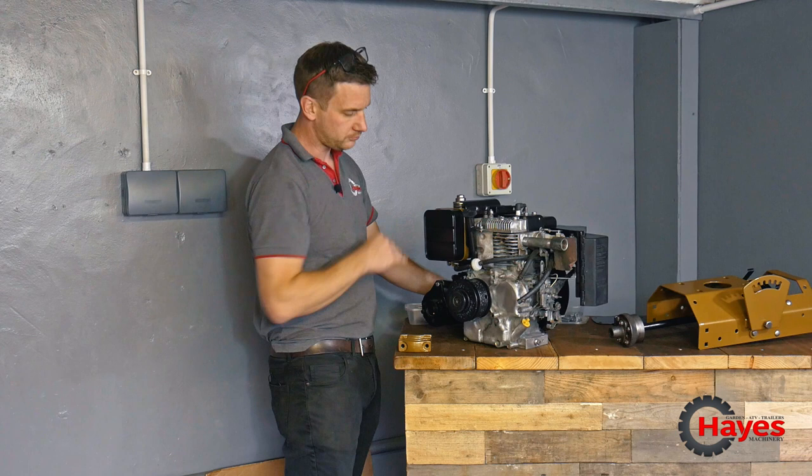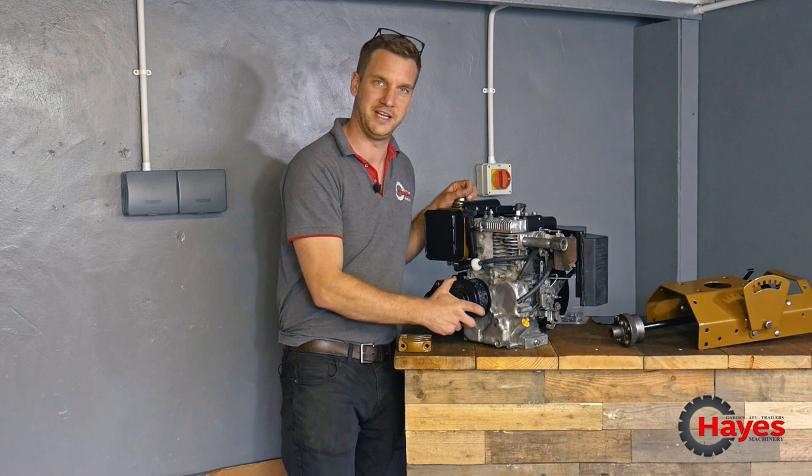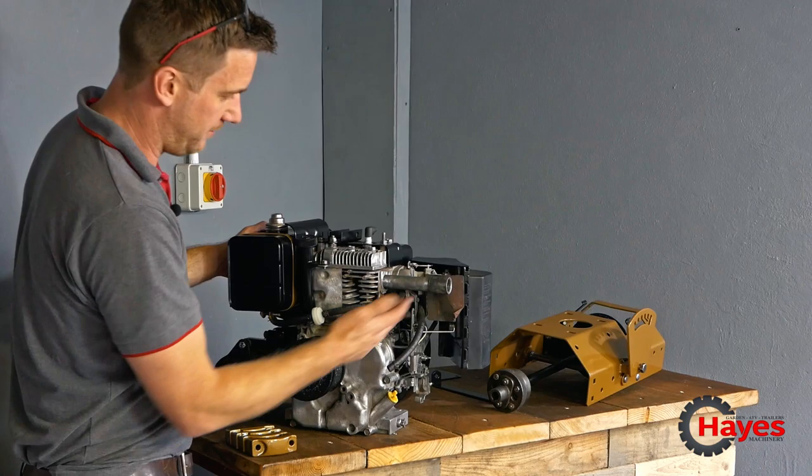We've got our main pulley, which came off really easily, went back on. I powder coated that. Probably we're going to regret that because I think it's going to have too much traction on the belt, but we'll wait and see what happens when we run that up. Cleaned up the engine best we can without having to strip it all down completely. And new fuel pipes all the way through.